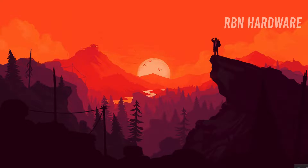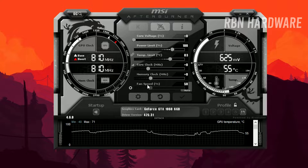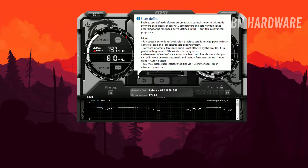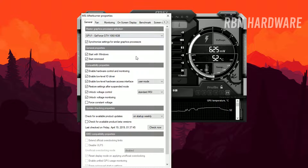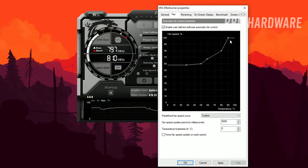So you need to quit Fortnite first. What you want to do is download a software called MSI Afterburner. This is what it looks like. Once you download it, you want to fire it up. If you take a look at the middle here, you see something called Fan Speed, and as you can see, it is now set to auto. You can, however, set up your own profile. If you click this cogwheel here, first you want to click the bigger one and go over to Fan. You want to enable this, and here you can set up your own fan curve. At 70°C, let's say 60% — this is where my fan starts to get annoying.